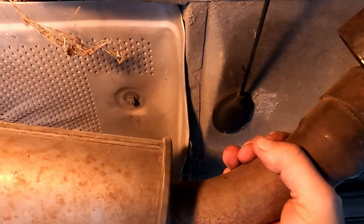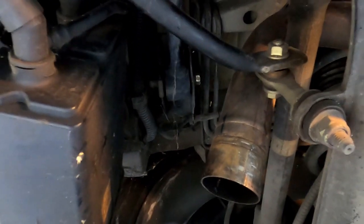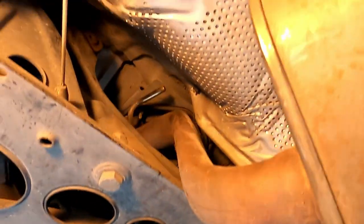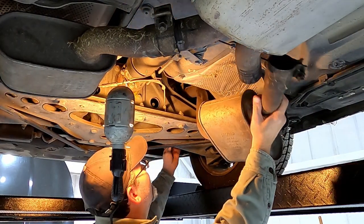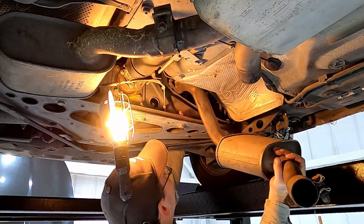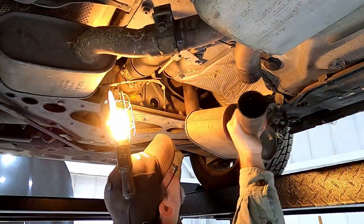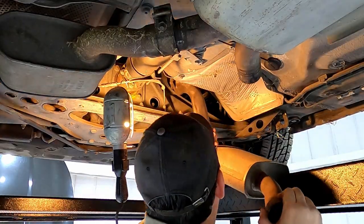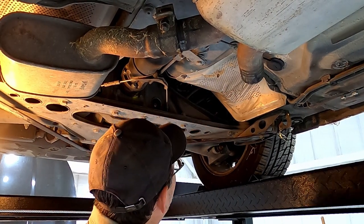What I was able to do is move this silencer completely off the big silencer and get its pipe actually above the other one. That enabled me to slide it up higher so that the rear pipe was not hitting that brace anymore, giving me a little more gap and the extra movement I needed to get that pin out of that grommet. At this point I'm just going to finagle this tube up and around — you kind of have to rotate it to get it out. The lift is a bit in the way, but fortunately it finally did wiggle out.